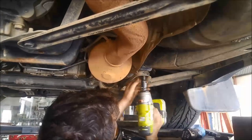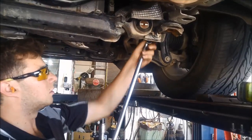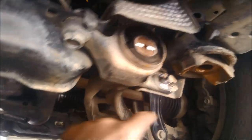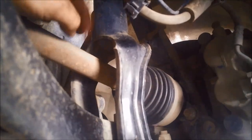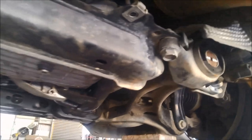On these there are 13mm — there's two over here and one over here. We've taken the nut off that one, and taken the nut off that one. Now before we pull that bolt out — that's acting like a pin — this whole thing will lower or drop down a little bit until that strut hits that axle shaft, the CV shaft there. So we're going to support it with our jack just so we can take those bolts out. We've got a bit of tension there; now we just lower it down so we can pull this bolt out.